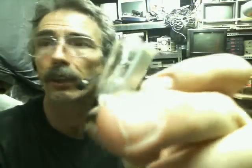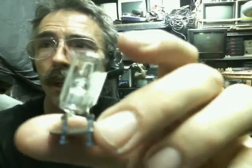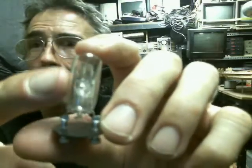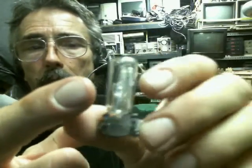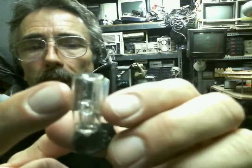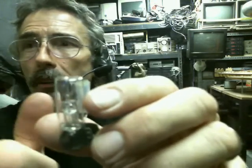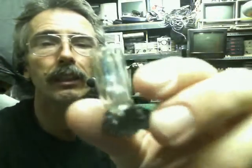Inside the canister, this is what they look like. This little deal right here is a condenser, and inside there is argon gas and a little gap between there. What happens whenever you turn your AC on, it heats up that little deal, which causes it to make connection real quick and fires up your fluorescent lighting system.